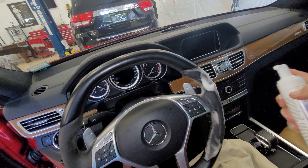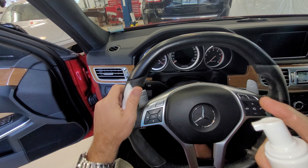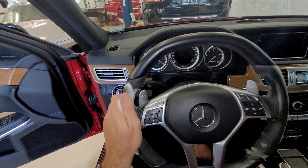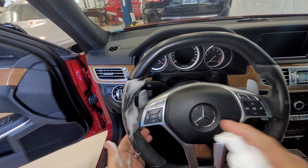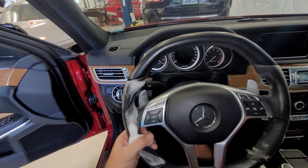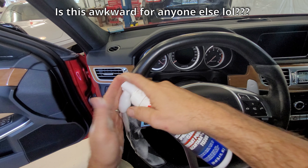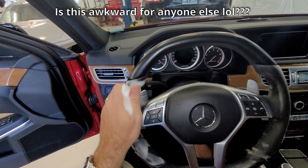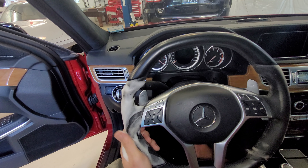So here's the plan. We got a towel in our lap. We're just going to take some of the Sonax, kind of just foam it on here and keep it out of your buttons and just kind of work it around. If you use a brush, there's a good likelihood you're going to get these like lint bump look all over. It won't be smooth anymore — you'll have little balls of Alcantara everywhere. So be very gentle with it, just let the product do the work. We're just going to massage it in with our hands and then let it sit for about 10 minutes and then blot it up with a clean rag.